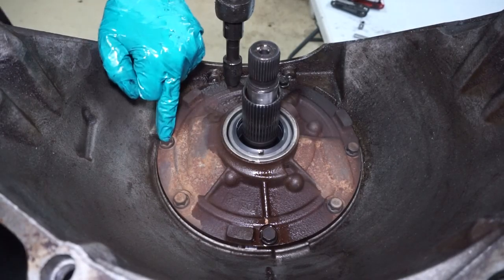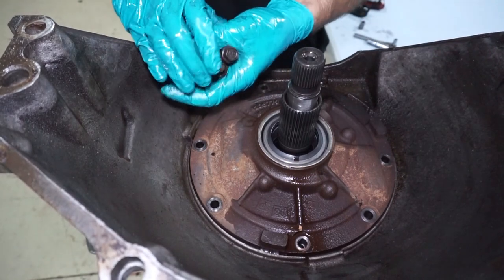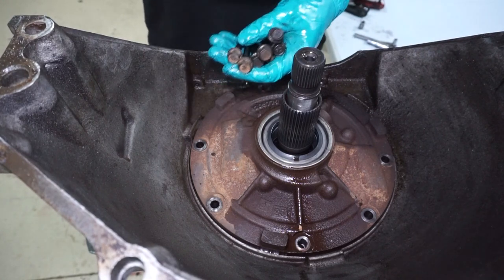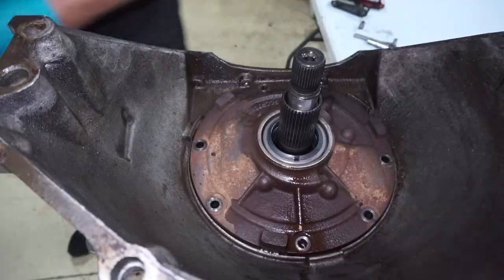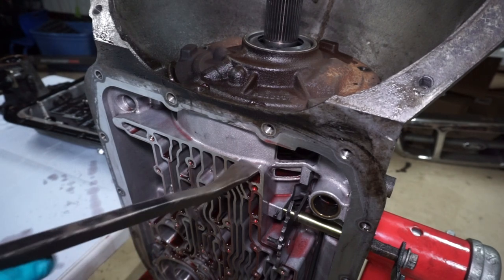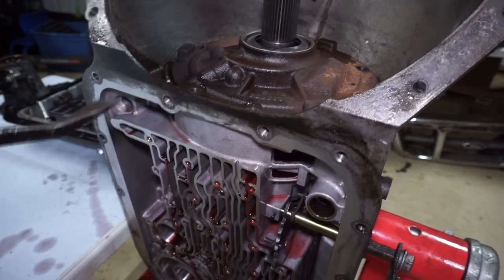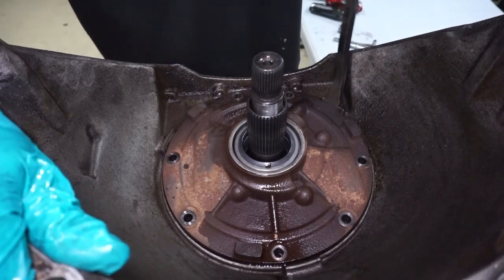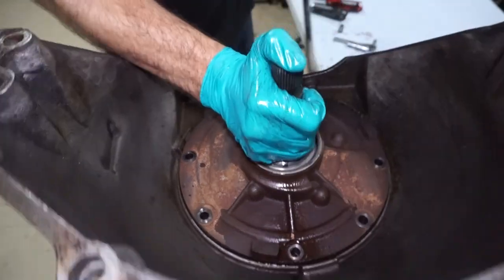Next, we're going to take the pump off — these are just 13 millimeter bolt heads. Bolts like these I try to keep separate from what's in the pan, like all the valve body stuff. I'll take it and put it right back in the pan, but bolts from the tail housing I'll leave outside the pan because I don't want the dirty bolts mixed in with the bolts that are going to go in the valve body. Next, we're going to start to pry the pump out. There's two little slots back here where you can get some leverage behind the pump — just be careful not to put too much pressure on it. After I pry back here a little bit, when you see the surface of the pump start to lift up, you can come around and start to pry a little bit more, then grab the pump and pull up with your thumb while prying around it.